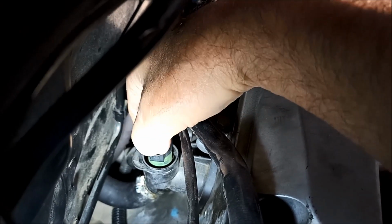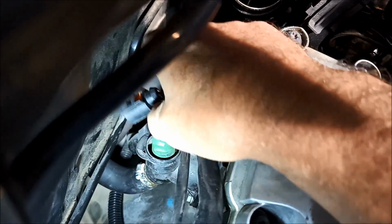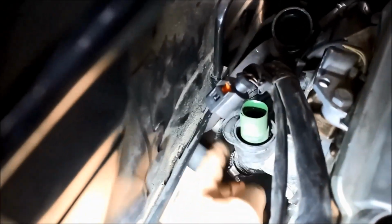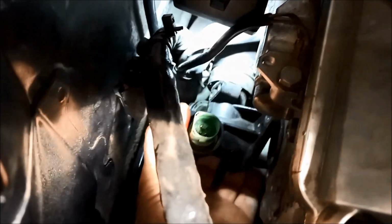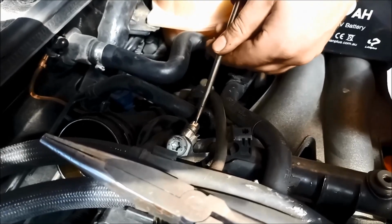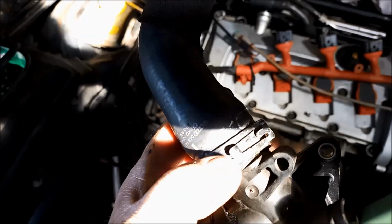And you can poke a screwdriver in there and I think it releases that clip and that just comes out like that. Got the 2 bolts off and you can see we can now just sort of twist it around a little bit. Probably much easier to just take the top end of that hose out. Okay, a lot easier that way than getting that little clamp off there.